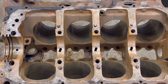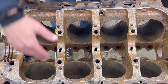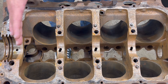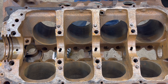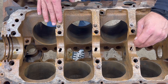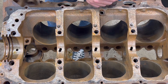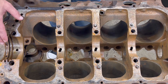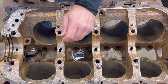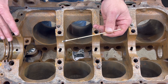Here's another reason why you want to go to a machine shop. You saw how contaminants stayed on the outside — there's still some in here where you really can't get a brush in, and frankly a lot of that's baked into the cast iron. I have used bore brushes, different cleaners, different degreasers, and really, really scrubbed on this. Mind you, you're rebuilding an engine — you start putting different chemicals to it and you are going to break stuff free. Look at that — grossness. You're going to find that in every single hole. Mind you, these are feed holes for your main bearings, and it also goes the other way for your cam bearings.